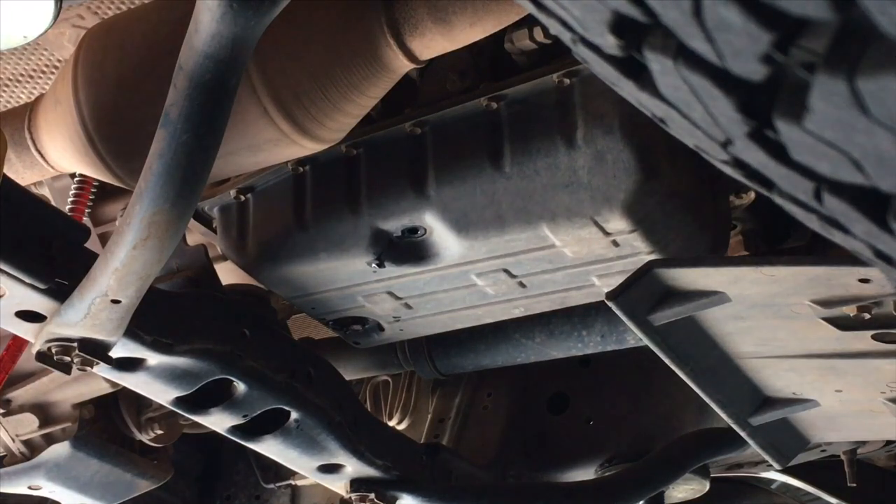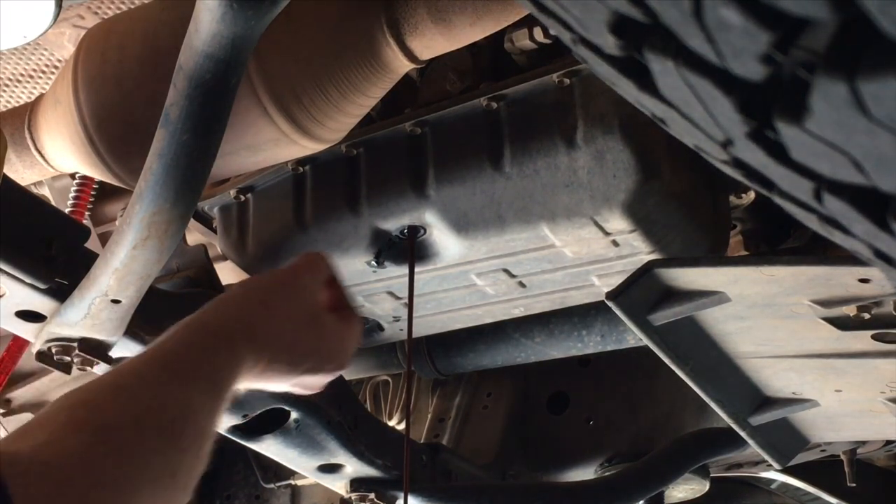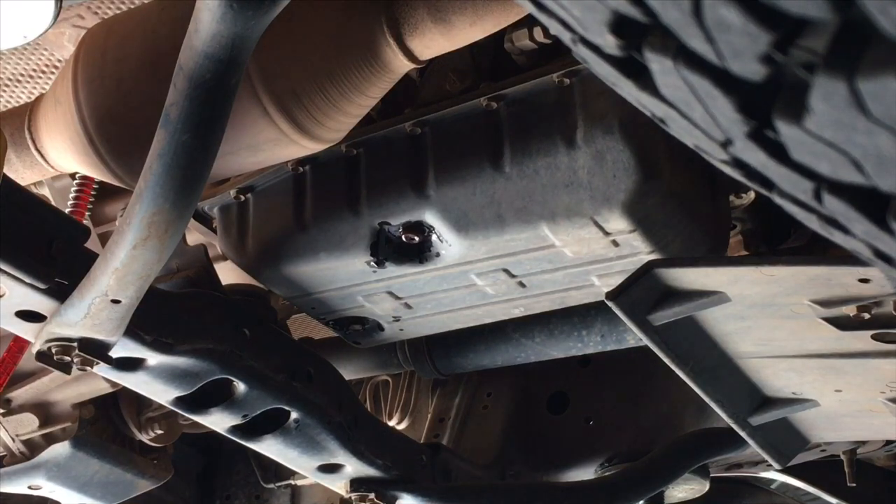I know a guy in Brisbane who used to set transmission levels with the engine not running — actually wanted to argue about it. After triple-checking my information I was able to correct him. The oil coming out still looks a little bit grotty so I'm going to keep pumping a little bit — this is almost part of my flush. When I see it start coming red, that's when I'm going to put that check plug in. You need to have the engine running for the correct level.